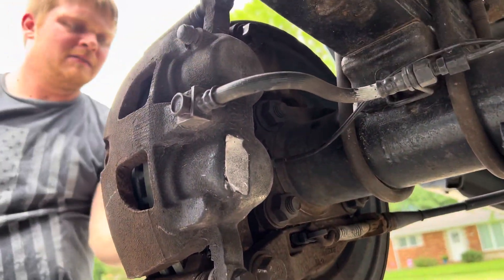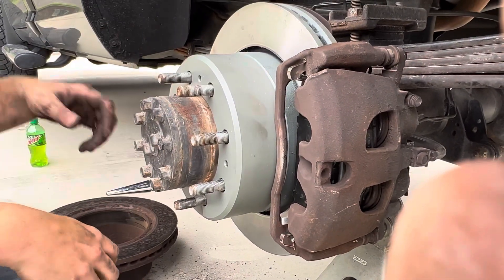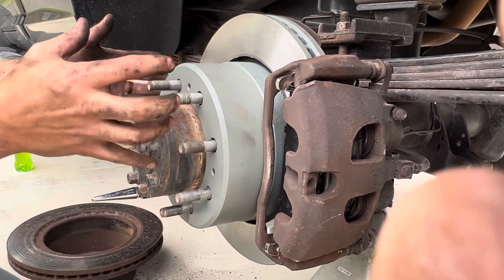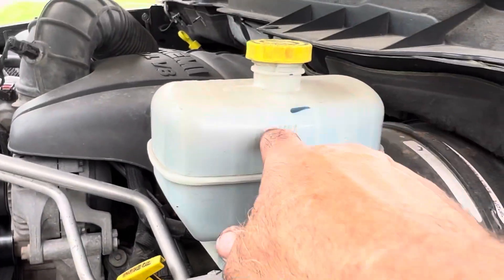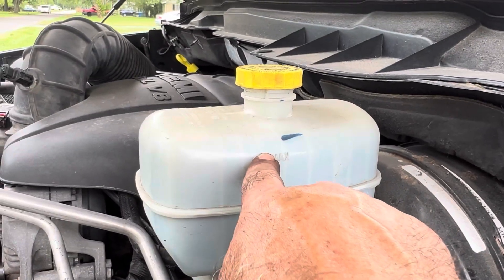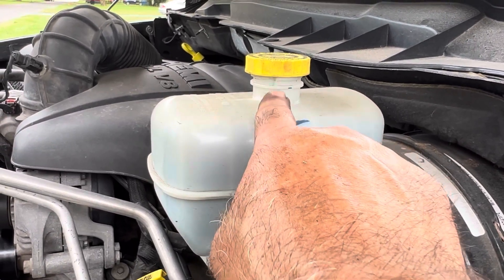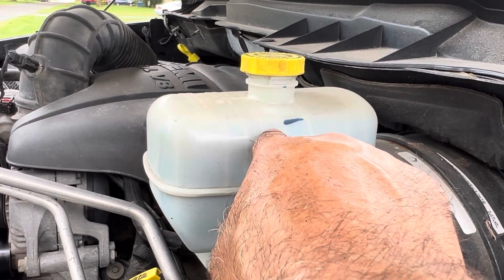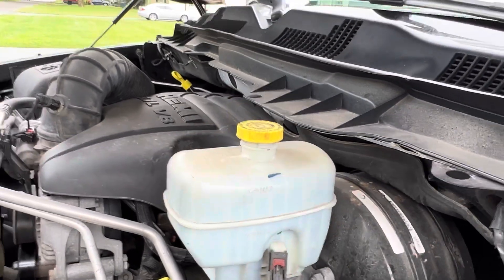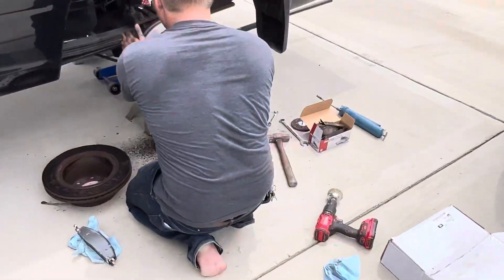Take your lug nut back off — just hold the rotor in place. You can take it off now or wait until you press the brakes and they'll hold the rotor in place. Whenever you push that caliper in, you raise your brake fluid. So when we push it in it'll raise it more, then we'll tighten the cap. Once you pump the brakes a couple of times, that brake fluid will go back down because it'll start pushing out on that cylinder, and then you'll know if you're low or high.